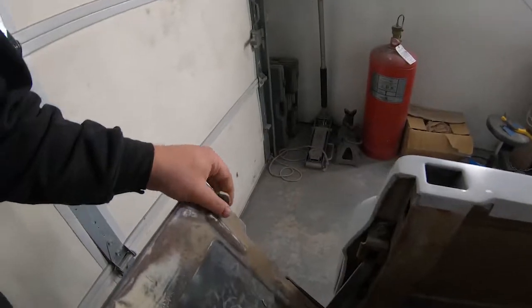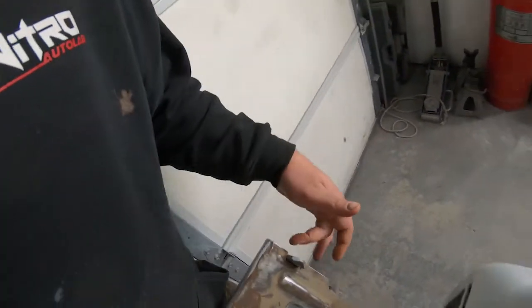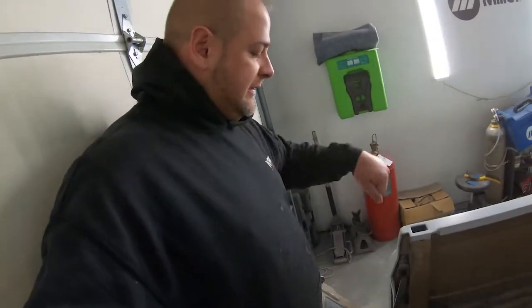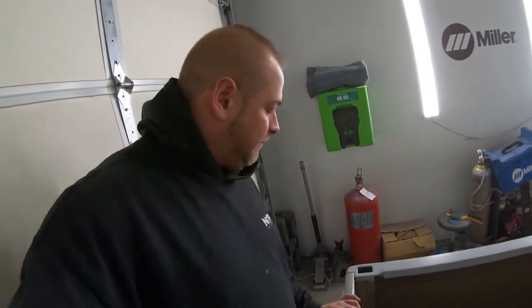In the jam of the tailgate and any areas that are hard to sand, I have a very aggressive wire brush that I stick in there — it loosens things up and puts a good scratch on it. We're looking for a good mechanical bite. The wire brush also helps get dirt and debris out of corners and crevices, and we'll rely on cleaning it well with wax and grease remover for both a mechanical and chemical bite.